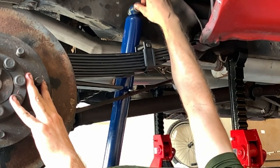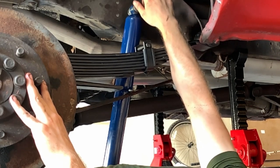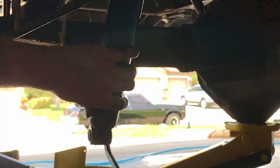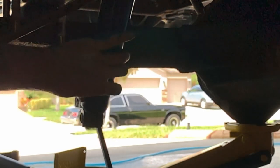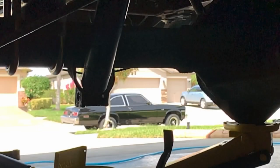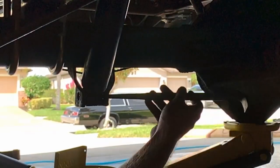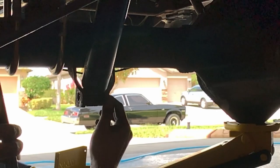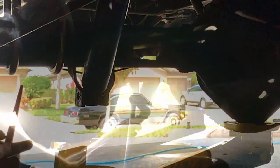It's important not to actually torque down your shock at this point as you'll need a little bit of play in order to fit it into the rear mounting point, which is notoriously not straight in these older vehicles. Your pry bar is a perfect tool to help compress the shock and get it up and over the top of the bottom shock mounting housing. Once you've placed it inside the housing, you'll need to massage it into place either by hand, using the mallet, or another good tool — your tapered edge crowbar. Once you've been able to align the holes to get the bolt in, go ahead and emplace your mounting hardware, and at this point you're ready to tighten and torque both the lower shock mounting bolt as well as the final fastener on the outside of the upper shock placement.